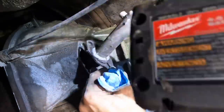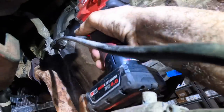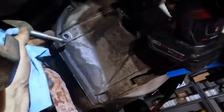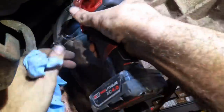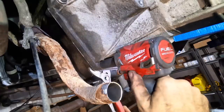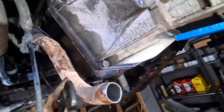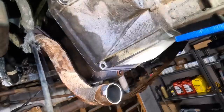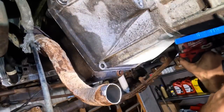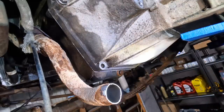Come out, cylinder. Looking left, there's a little bracket that holds this hydraulic line. Get that out — that's also one of the bell housing bolts. I'm just going to leave that here for now. It's got a nut. There's another one far away so let's pull that one out next. Let's go to the other side and take the starter out. We're here on the right side of the engine. Starter's got two bolts — one from the back side up here and one from the front right here.